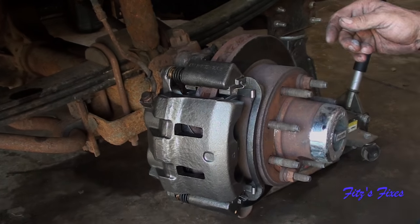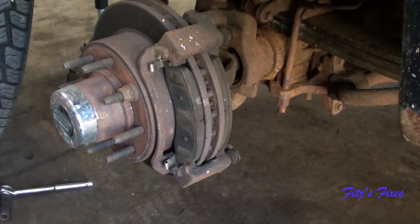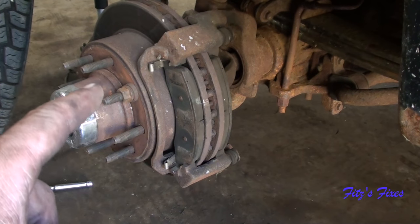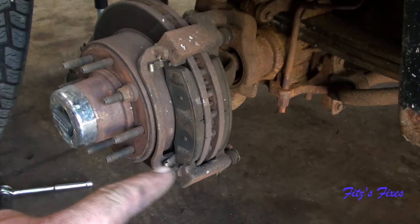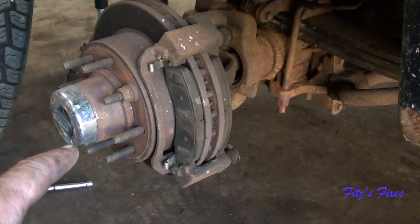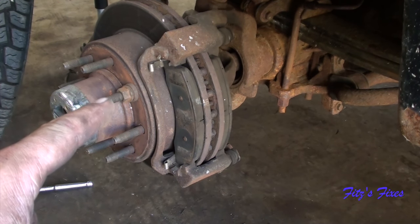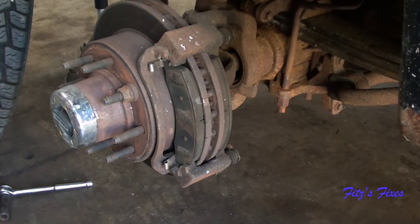On the other side now - I bought a set of pads so I'm obviously changing both sides, because you don't want mismatched pads. Even though these ones are almost new, they're a cheaper version and they'll wear differently. I did take it for a test drive before pulling this wheel - and I almost left those lug nuts on the other side but caught them in time. The test drive was perfect: no vibration, no pulling to either side, stopped perfectly. I'll go ahead and change these pads out and call this job done. Thanks for watching, please rate, comment, subscribe, and have a wonderful day.